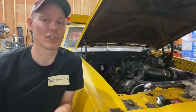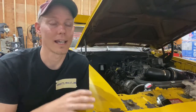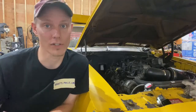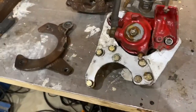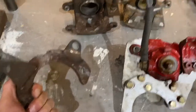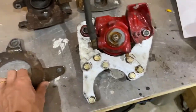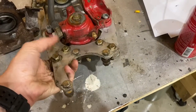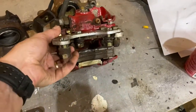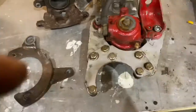Although sometimes it's not. The second option is to buy all of the brake parts from some car that you know has good brakes and adapt them onto your project car. That may mean you have to make all kinds of brackets to mount a caliper to a vehicle that was never meant to have a caliper on it, or in the case of a rear brake, make brackets to attach a caliper to a rear axle housing, which can be kind of a pain.